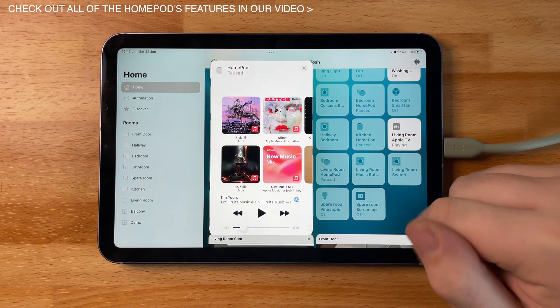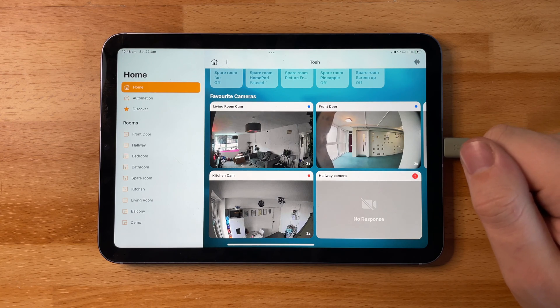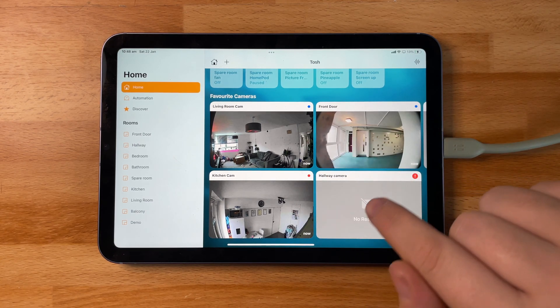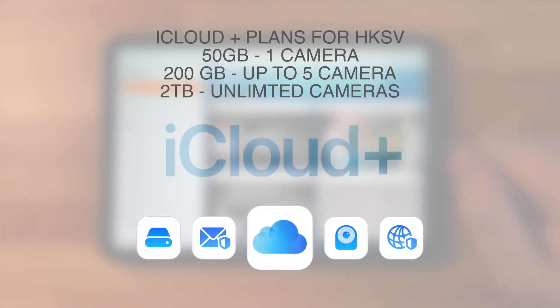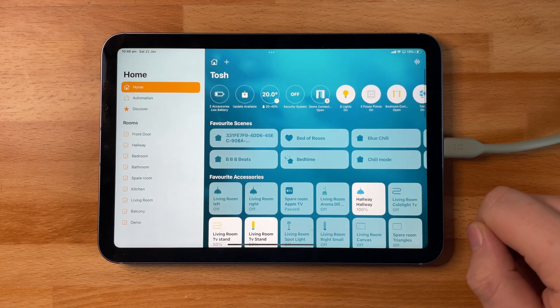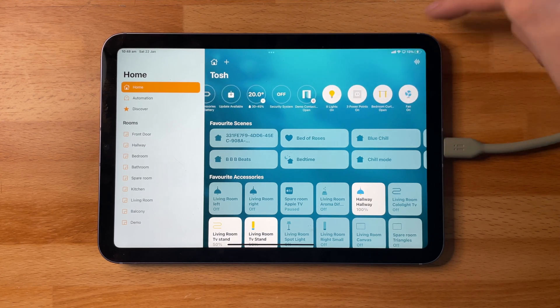If you need help setting up your home hub such as Apple TV or HomePod, I've got two separate videos reviewing those units which I'll link at the top and in the description. At the bottom of your home page you're going to see all of your HomeKit cameras — in the top right corner of each panel you're going to see either a blue or red dot. Blue means it's not recording but allows you to review the live feed; red means it's recording on HomeKit Secure Video. HomeKit Secure Video is a subscription-based service through iCloud starting at the 50 GB tier, which allows up to 10 days of video footage access. At the base tier you're allowed one camera; the 200 GB option gives you five cameras; and the two-terabyte option gives you unlimited cameras.